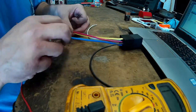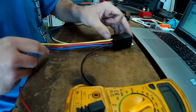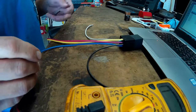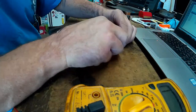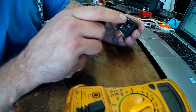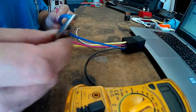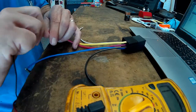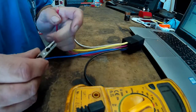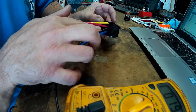So if we take our pin 30 — it's going to vary depending on where you get your relays from, the colors of these wires are going to change and vary. It doesn't really matter what color they are as long as they work well. So if we probe this right now, I'm connecting one side of my multimeter to the 30 pin and then I'm going to probe the other two, the 87 and the 87A, so that I can show you how those circuits work. So if we're putting power in here on our 30 pin, then we should have continuity here on our 87A. And that's the center wire here, the red one, on our pigtail.